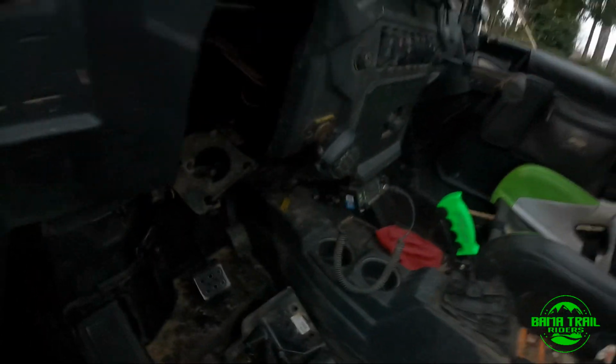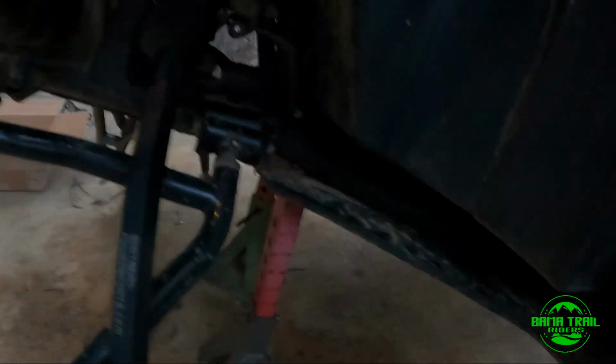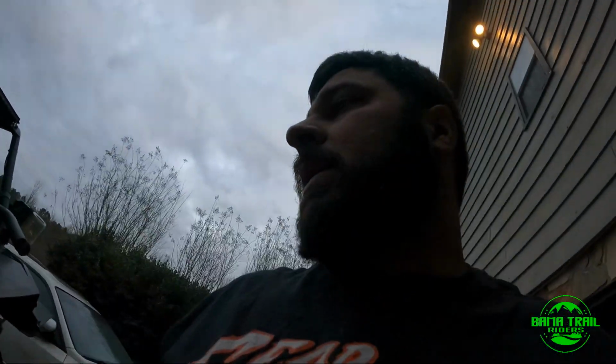So we come in here and we're gonna put this little grommet in there, and then my EPS will mount in there. You mount this before, and then you bring your steering wheel again, 2 bolts here, mount it right on. You end up beating your hands, because we've done it before when Adam broke his, I think, and it's a pain since your shaft is so long. If you got an XP 1000, your shaft is about half of the dimension of that one.